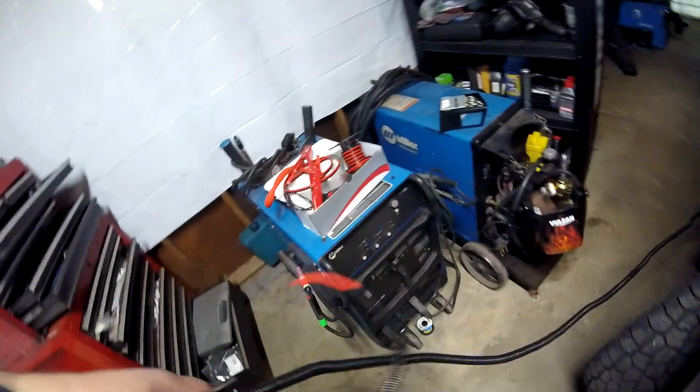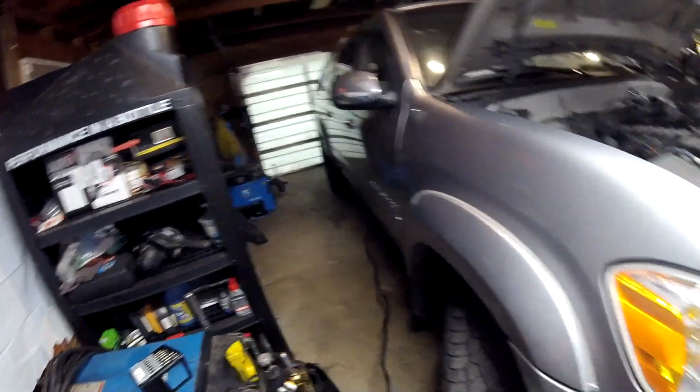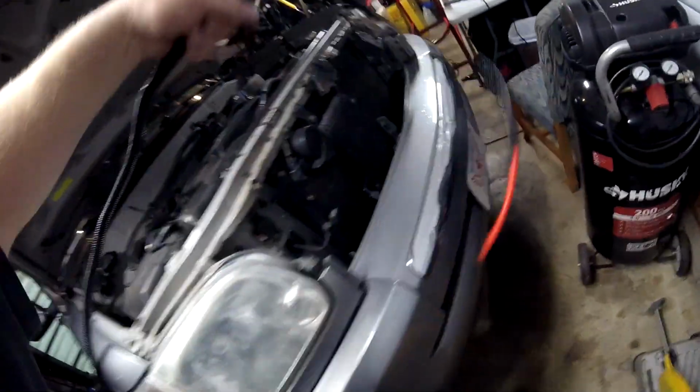You don't want this cord to hit anything that moves, like a control arm or a drive shaft. You don't want it to hit anything that's hot, like a header or a pipe. Nothing that can melt it or damage it. Okay, you want it to have a nice, safe place to live. I think our length is pretty good. That's the length coming out of the bottom of the truck. And we basically got to snake it over and get it up to there.